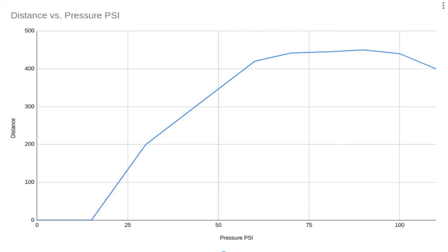I've plotted the results on a graph: the vertical axis is distance covered — just short of 500 metres — and the horizontal axis is tyre pressure in pounds per square inch. Between about 70 and 100 psi there is a noticeable difference. Between 90 and 80 psi there's about a 5 to 6 metre difference in roll distance for the same input energy, and if you translate that to a 10-mile time trial, you're talking about a 150-metre difference, which can be significant.